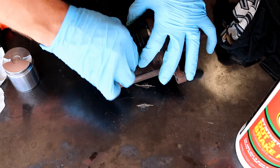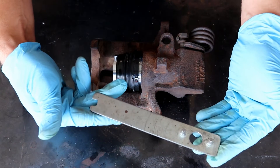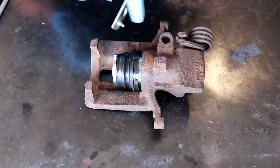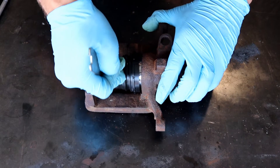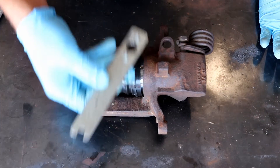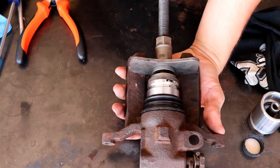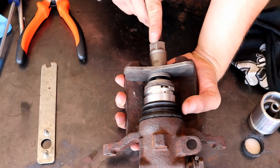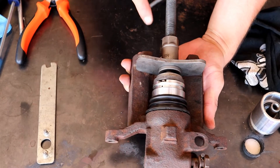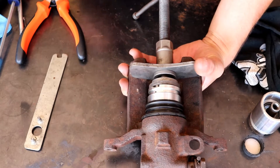We've spun the piston in as far as we can by hand. If you follow me on Instagram, I did an Instagram live showing a garage hack — the chuck wrench for my mini grinder just happens to be the proper spacing on the piston to work as a wrench. That way you don't have to go to O'Reilly's to rent a tool. However, I did break down and get the proper tool from O'Reilly's anyway, because while the hack was working, it felt like I might be cross-threading it. These rear caliper pistons require a special twist-type plunger tool, and this is definitely the right way to do it.